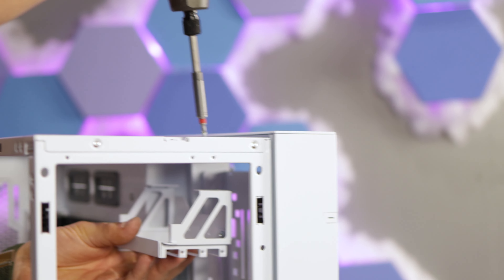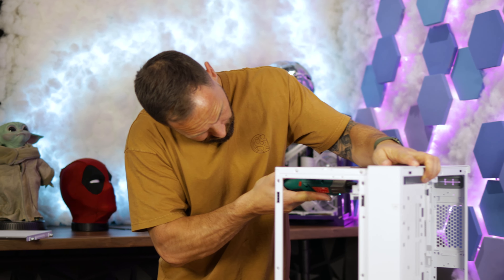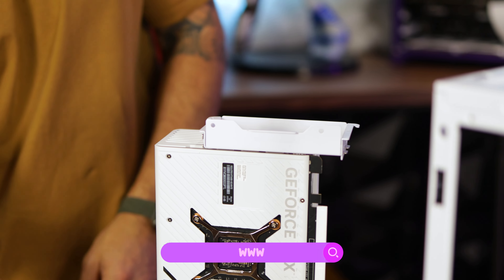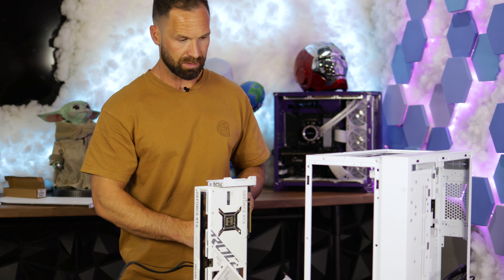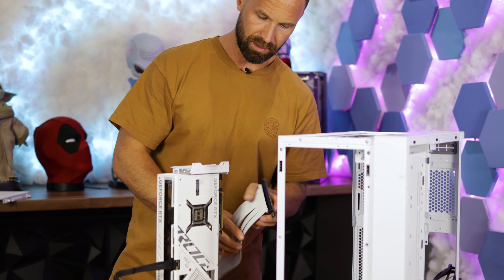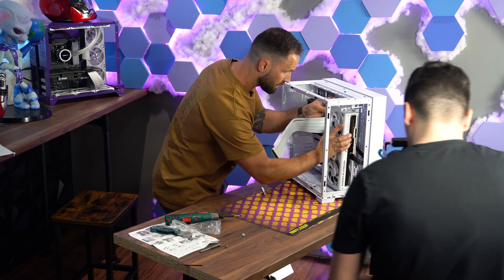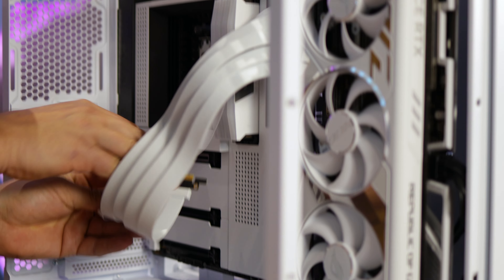Four of those and pop that into there. There's four screws on the top — you need to remove the top cover panel for this. So when you've got that bracket installed, take out the graphics card tray. Two screws, easy enough. Pop the tray over the graphics card, two screws — rounded ones. The manual says to put the cables in afterwards, but I think it's probably going to be more accessible to put them on first. So we'll put the Corsair power cable in and the Gen 4 riser. Two screws — the ones that we took out to get the bracket out before. Then pop the riser cable into the motherboard.